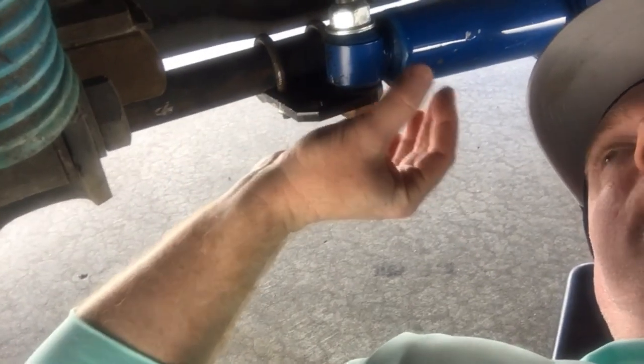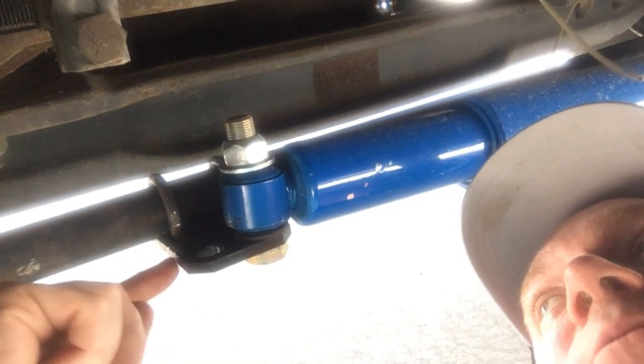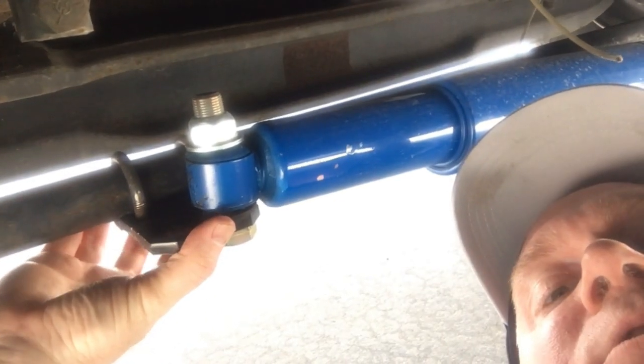I loosened the four bolts on the U-bolt, and the Safety Plus actually self-centered to exactly where I had the steering wheel set. I re-tightened the four bolts, then rolled the RV through the parking lot using the lot striping as my guidelines. I saw it was just a hair off, so I climbed back under — without loosening the bolts this time — and just hit the bracket and the top of the U-bolts a few times with a hammer to slide it slightly. Then I drove it home and it was tracking perfectly.